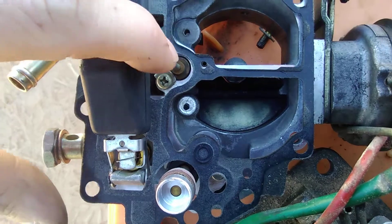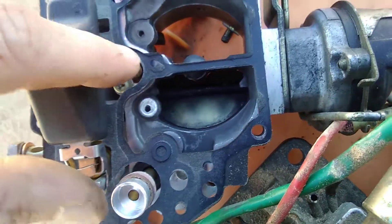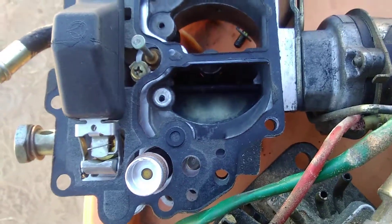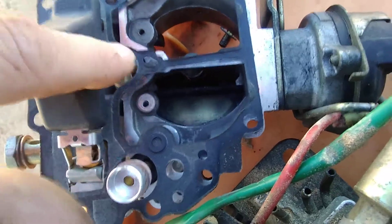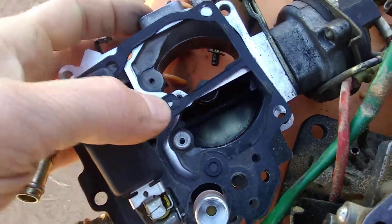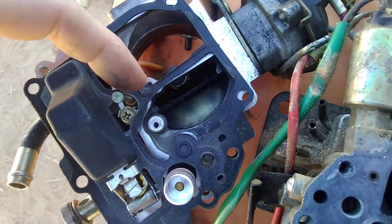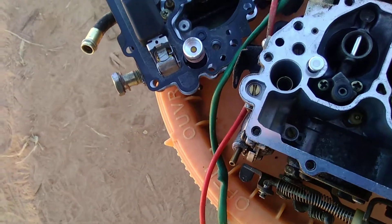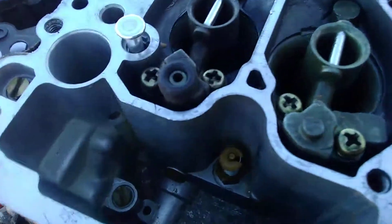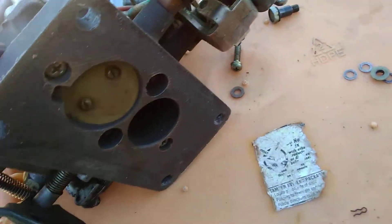The next thing I'd recommend: this part right here also pushes down on a little spring. If your solenoid was stuck, chances are this is stuck too, and so is your power valve. Sometimes you can just replace them — they usually come with a carb kit. If you clean that out and get the spring working right, this has gas going through it. Also take out the little Phillips head screw right there, pull it out, spray it all out, and make sure you see carb cleaner come out the little holes. That'll help get that secondary power valve opening and closing, and you'll feel a little bit of power when you hit the gas.